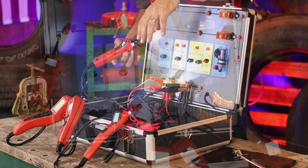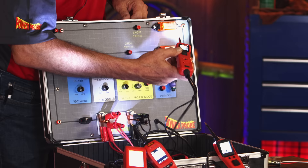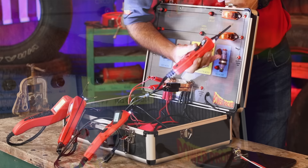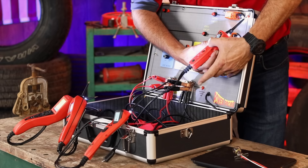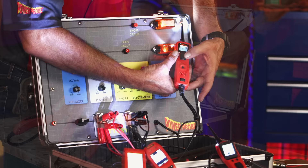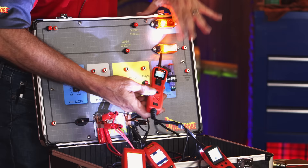We'll repair that. The light got a little brighter — we're back to 12 volts now. But they're still not as bright as they should be, so let's find out what's going on on the ground side. Same thing: if the ground was good, I should get a green light and no more than half a volt on the ground side. Up here we're showing 4.4 volts — that's not good. Here's a situation where I might use the rocker switch to apply ground and see how the circuit responds. Sure enough, the lights got brighter. That verifies there's nothing wrong on the load side — it's all on the ground side. So just like we did on the positive side, we find the wiring issue or connector issue in between, repair it, and now we've got full brightness and good grounds.